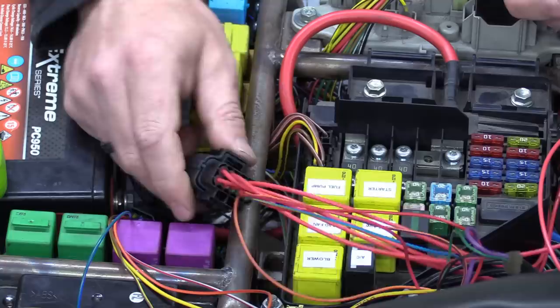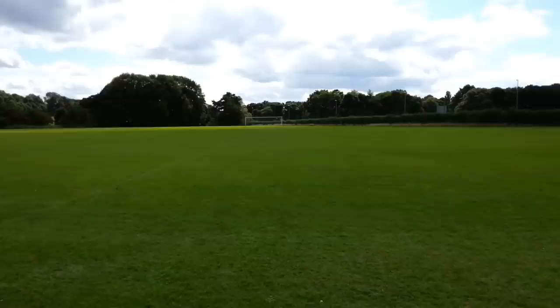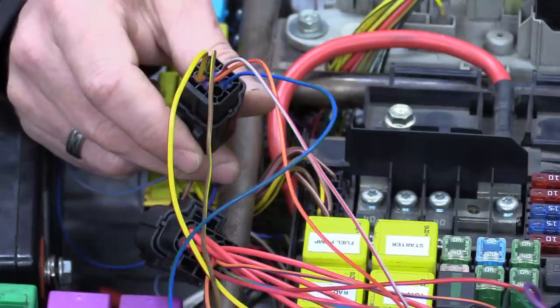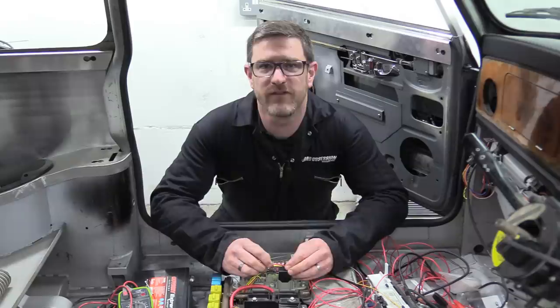This connects the ignition lives to the coils and the injectors and also carries power to the ECU, along with switching for the rad fan and the fuel pump, because that's all we need. This second plug contains feeds to other stuff that someone has since decided need controlling by the ECU. This includes, but is probably not limited to, the AC, the power steering pump, and the charge cooler pump. It's all in, but before I can call it done, I've got to configure the ECU and test it all.